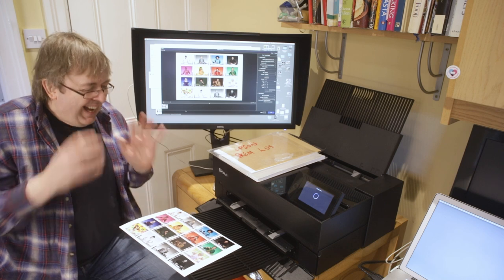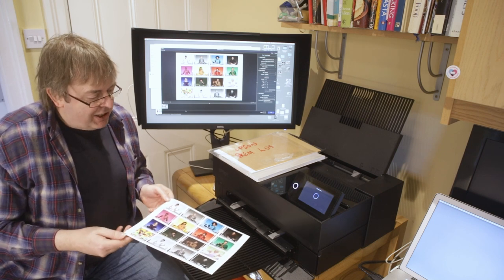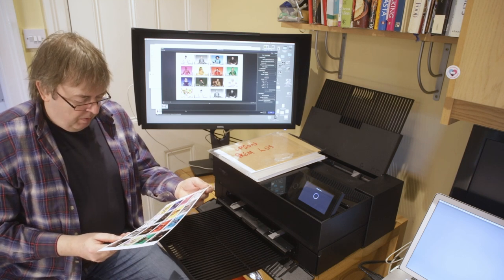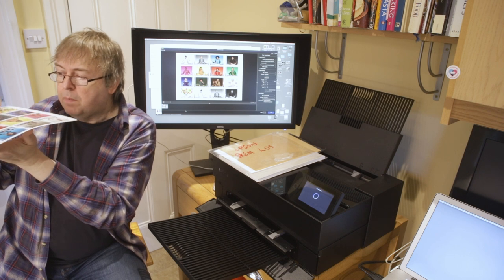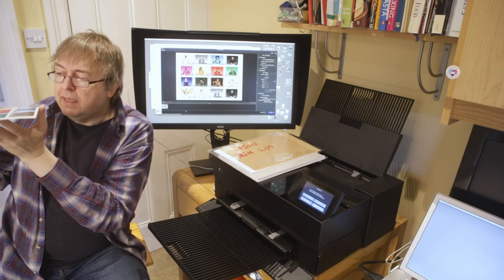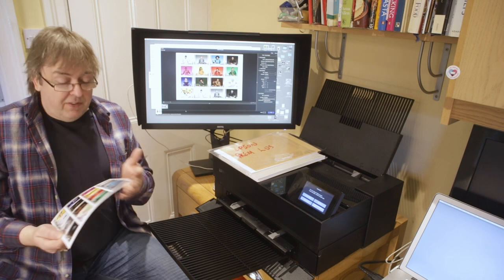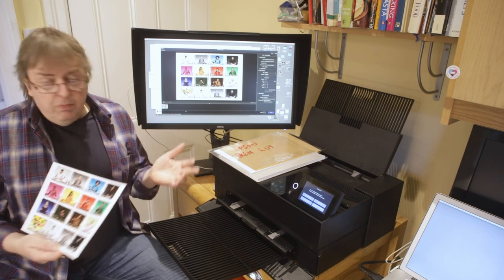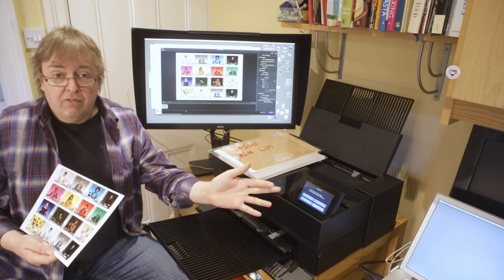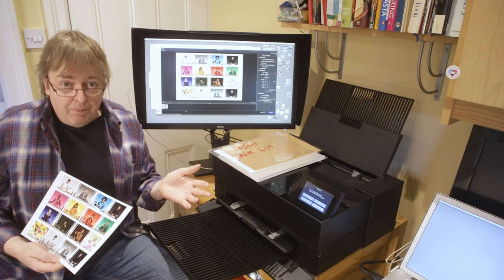There is the print. It's a little bit more awkward to use — the paper doesn't come out automatically. Pull the tray out to catch things, though you don't need to. There's the test print — it looks fine. The test for roller marks is to look at the paper at a glancing angle, and there is not a mark to be seen. That's how to use the no eject roller setting. A few media show roller marks — sometimes glossy film and ultra-glossy media can too. I hope that's been of use. Have a look at some of the other videos — I've got lots covering this printer and other printers and general printing info. Please subscribe to the channel if you find it interesting, and thank you very much.